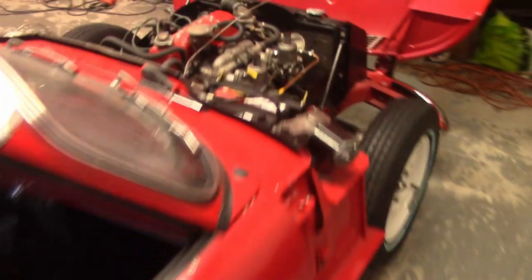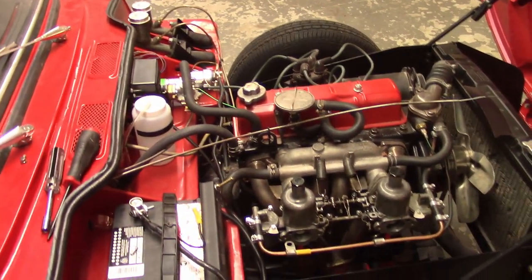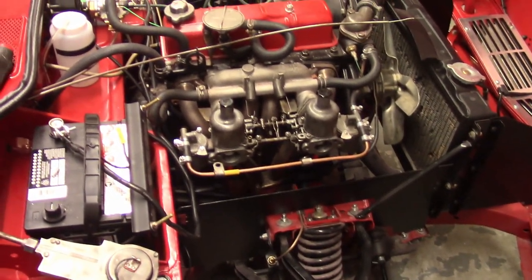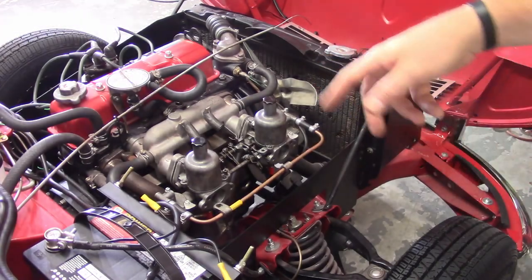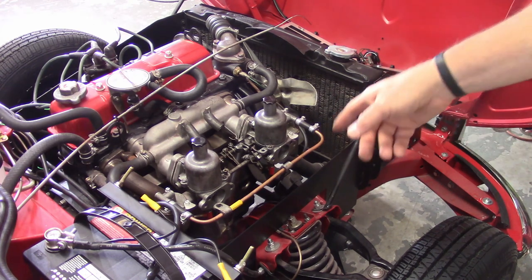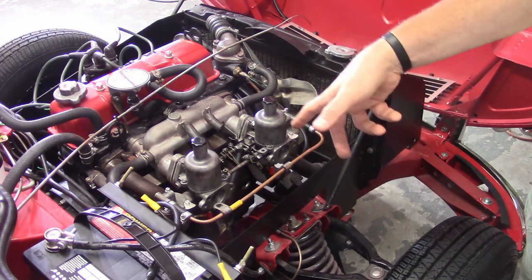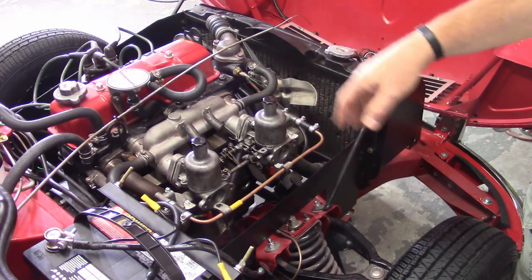I think that's a lot better — this one actually looks even a little bit better than the other one. You can just barely see it; it looks white on screen but it's more of a brass color, which tells me there's very little clearance. Now I've got the carburetors back on. I'm going to go ahead and get the float bowls primed using the lever on the fuel pump, get the car started. I had the idle adjusting screws dialed all the way down, so I gave each throat a quick shot of starter fluid — it may not start right away.